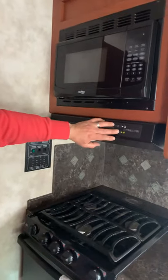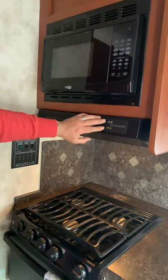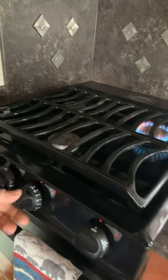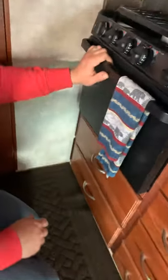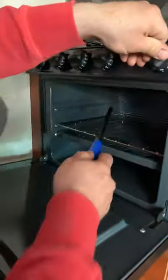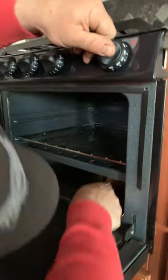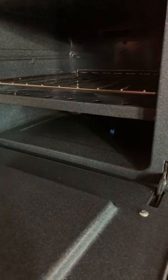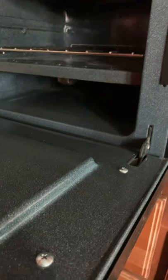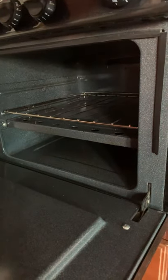As far as your stove — you've got your fan here, you've got your light, and these are running off your 12-volt batteries. Your stove: you turn it to light and that's all you've got to do. Your oven is a little different — not many people use it, but if you choose, it's kind of like a hot water heater at home. You're going to go to pilot and reach all the way in there, hold it and hold it for about a minute. Once that pilot light's lit, then you turn it.